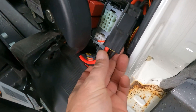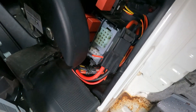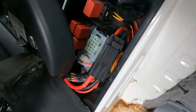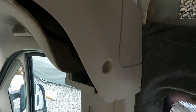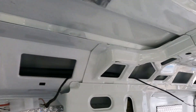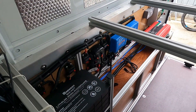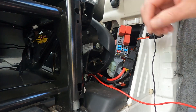Here I've already managed to pick up a DC to DC feed which runs to my C-Tech, and I'm sure in there somewhere I'm going to find myself an ignition live feed to run to my Victron unit. I run my wires all the way up this B pillar, all the way along the top of my van, and most of those wires are now running down through there feeding my charge control system. I've found an ignition live supply that I need here in the B pillar in this unit just here.